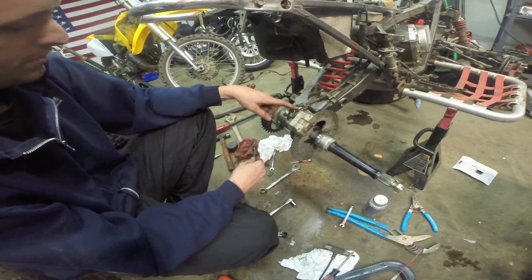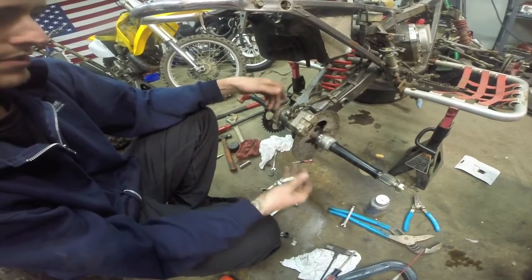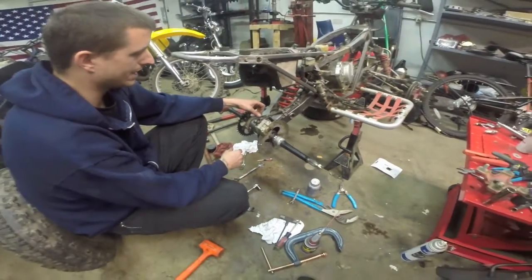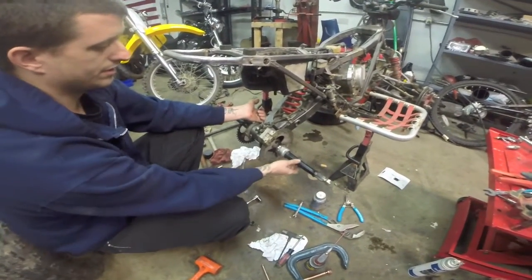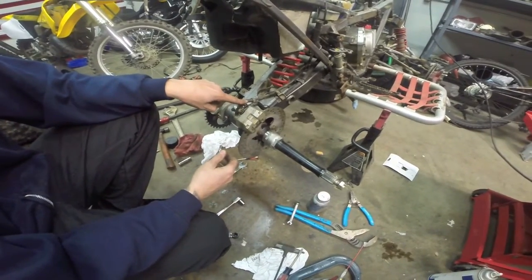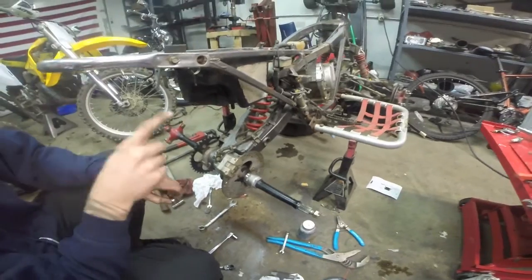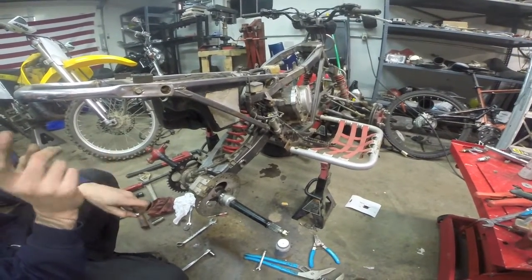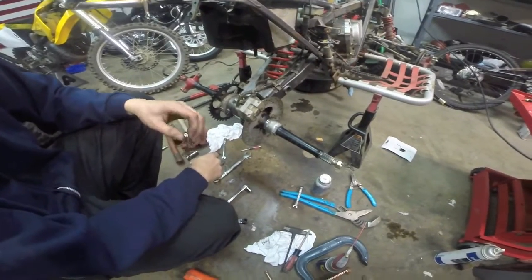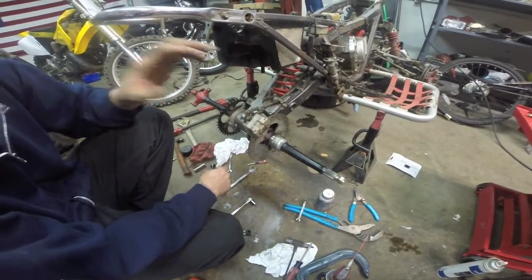You're going to want to install your tube at this time as well, into your soda can or soda bottle — or just let it fly out of the fitting; it doesn't really matter. We just try and keep it clean if you can. Once you're done, close the bleeder valve back up and put your dust caps back on. Also check the fluid level once again when you're done to make sure you didn't drain all the fluid out of your reservoir. So that's how to do the back brakes — we're going to move on to the front.